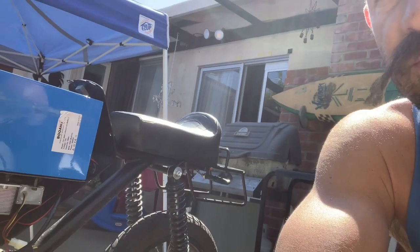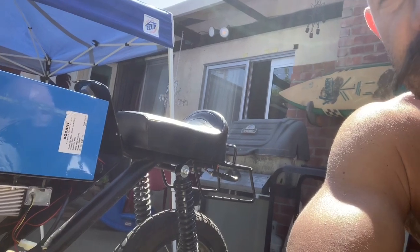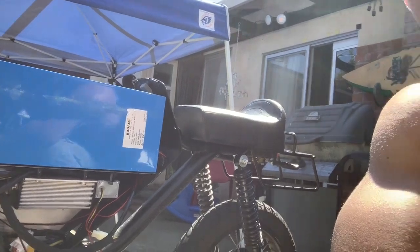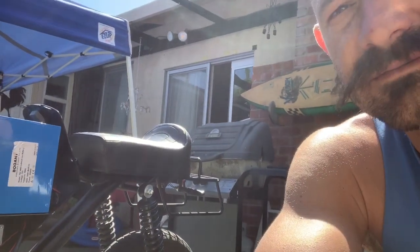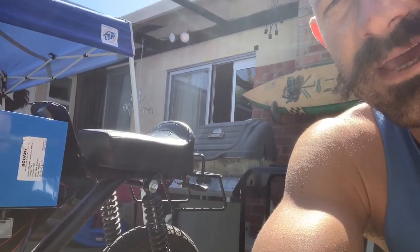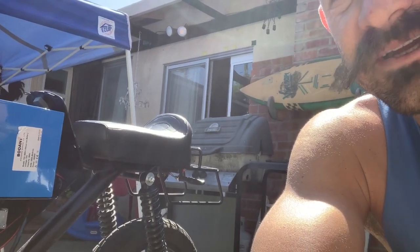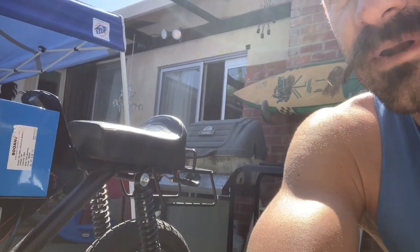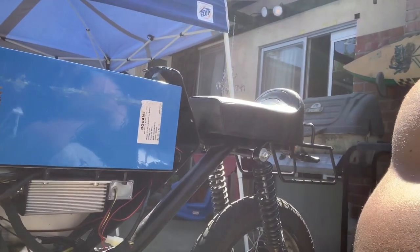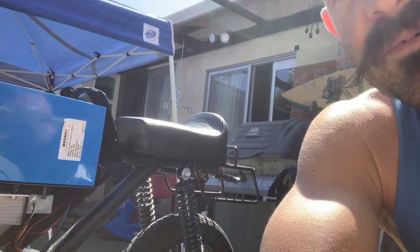I just told them how many amp hours I wanted and the size of the BMS. For this one I decided to go with a 150A BMS. I've heard different things on the Kelly 7230 controller — since they don't show amps and go by phase amps, no one has a specific number to monitor, but I've heard anywhere between 100 and 120. So I made the battery 150, partly thinking maybe one day I'll put a different controller in, or alternatively move the battery to another bike.